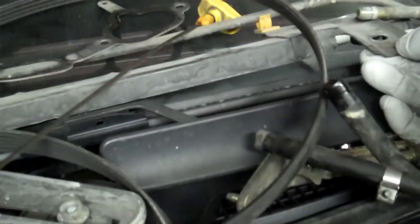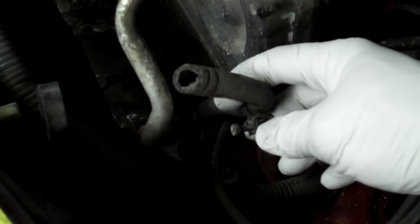So I pull out the radiator by pulling this bolt, and then you pull out this fastener. To do the fastener here, you just take a screwdriver and just pop, pop, pop, and it comes up and out. And once you do that, this whole big bracket piece that you see laying here comes out. So you pull that out and then disconnect the transmission lines. One of them is done on the front up here, and then the other one's done down below.